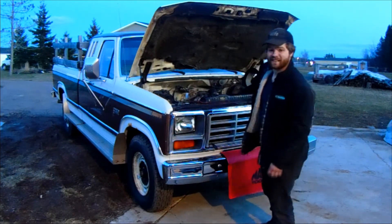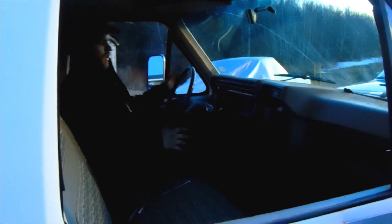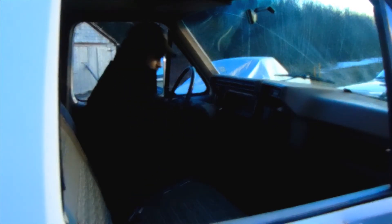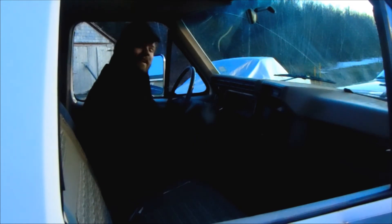I'm going to put this whole engine back together real quick and then we're going to hop inside the cab, turn that key through a glow plug cycle, and it should start right up. You turn your key on — the wait-to-start light is going to stay on, which is one of the problems with this truck — but you can audibly hear the click when the glow plug metallic strip is up to temp. There it is. Turn the key and it fires right up.